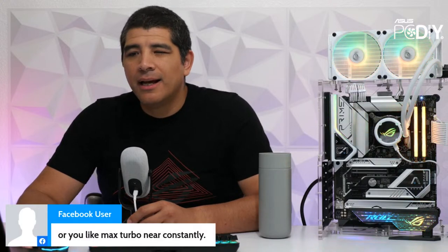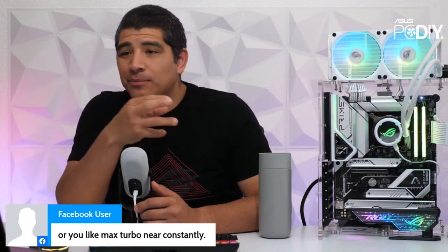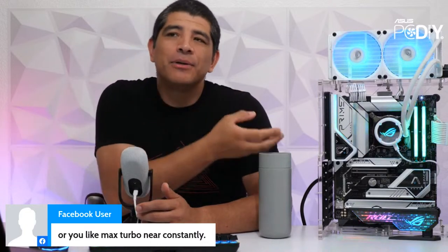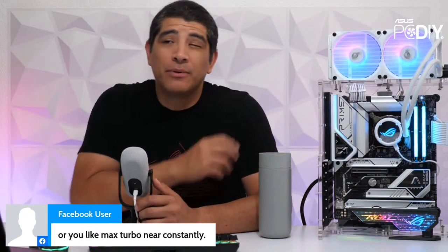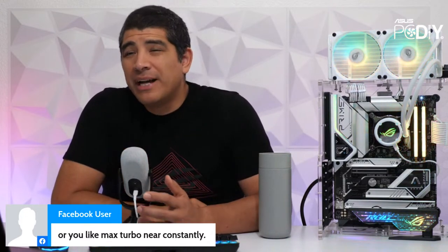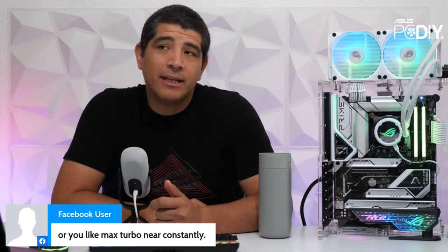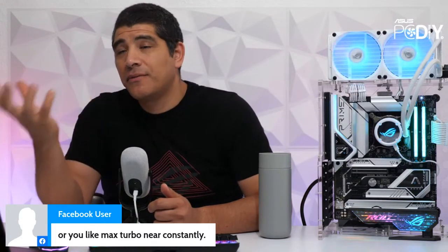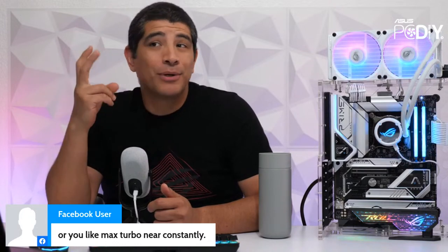And again, somebody was asking about max turbo constantly. That's where I go back to the point I talked about. If we have a lot of people that really want to know this, I can show you what I'm talking about in a demo on this demo system next to me. But the reality is that max turbo is already defined by Intel, right? But max turbo values can be influenced by your power targets, such as if you have MCE versus you don't have MCE, you're going to have a different quote unquote max turbo.